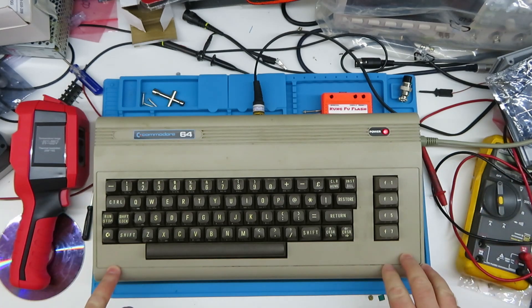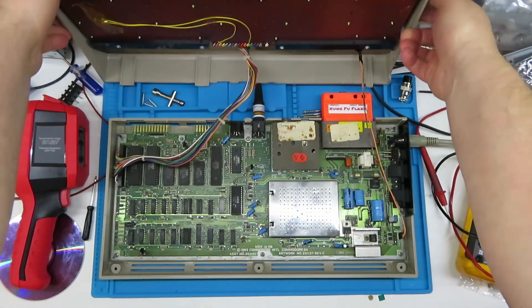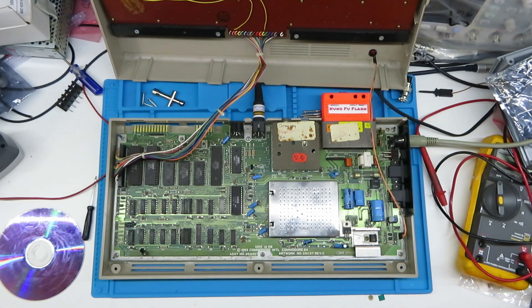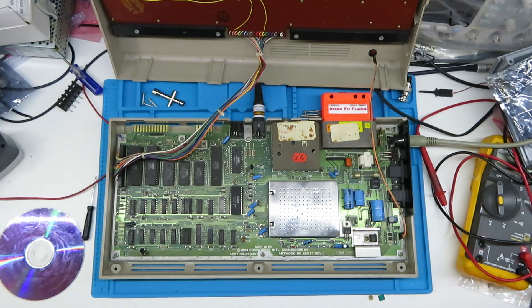Let's take this bread bin here — the junker. We'll lift the lid and we can see it's still running. We've got a metal can over the top of the VIC chip. This metal can acts as a heat sink. There's a piece of copper behind it which has a lower Celsius-per-watt rating than the steel casing, so it transfers the heat to the casing. We'll fire this up and capture it on OBS so you can see.